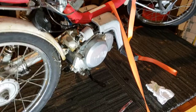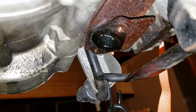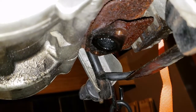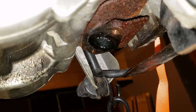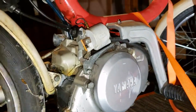We got the muffler off. The two bolts down here holding it on to the head area — we had to soak those with some WD-40 to get them to loosen up. We did that for a couple of days: squirt a little on and work them tight-loose, tight-loose to make sure they come out without breaking. These two bolts here and here are put back in place to save them.